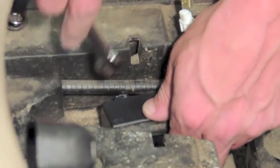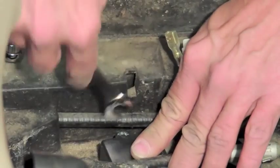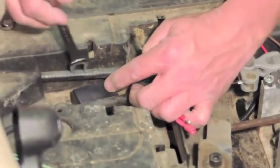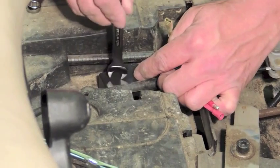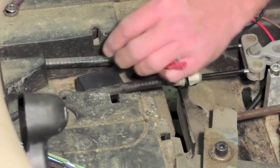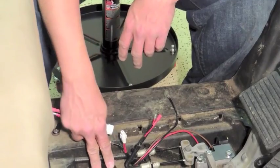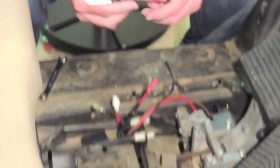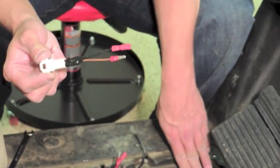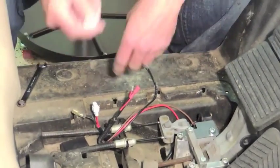Get this lined up with the hole. Because it's tough to get your hands down in with everything else, use a wrench just to press that down through there. We have our quarter-inch bolt through the hole in the floorboard that's already there. You're going to need a 7/16 wrench or socket — go ahead and tighten that up from underneath. We now have our time delay relay mounted. We're going to use the LGT142H harness to connect the brake switch to the 699 harness and to the time delay. This is the piece that bridges everything together.